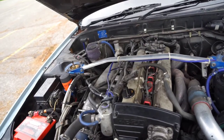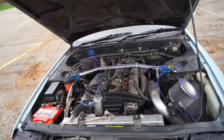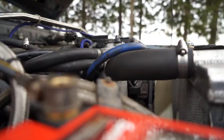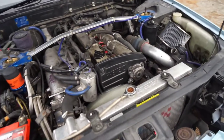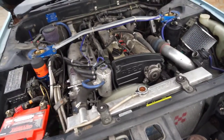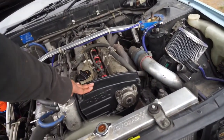I would love to replace the thermostat eventually. The car runs — let's give it a start. Now you guys can hear the little whining noise. Amin told me to drive a couple hundred kilometers so that the belt goes through a couple of heat cycles — it goes hot and cold, hot and cold — and expands and contracts, coming to the shape it's supposed to be.